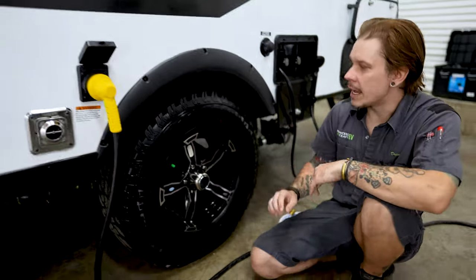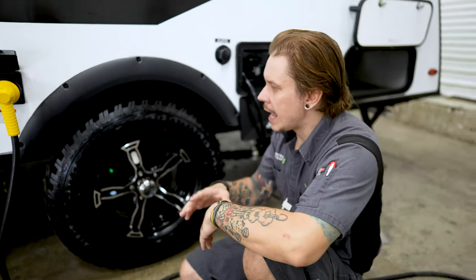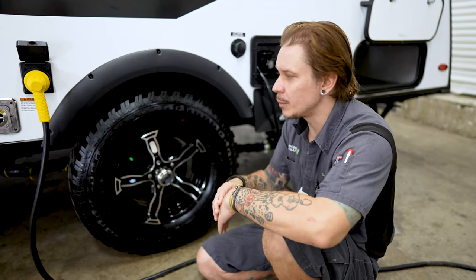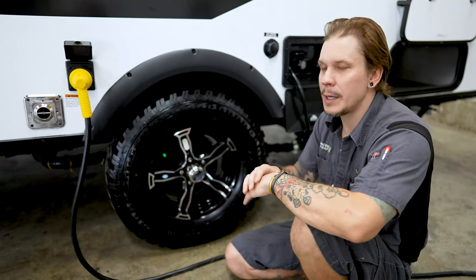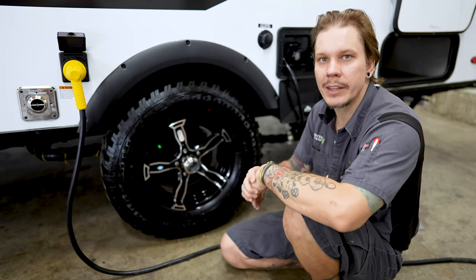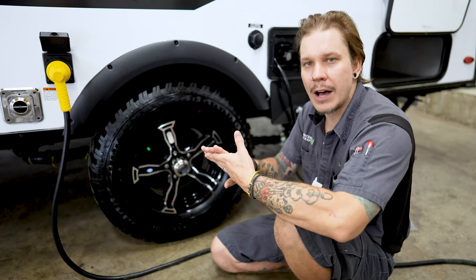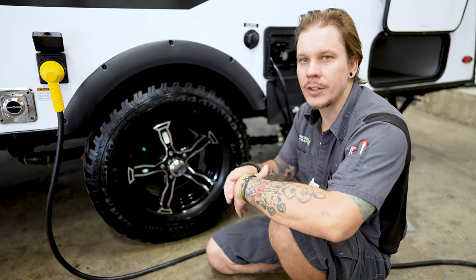Moving on, we have our tire pressure and lug nuts. These are very important with any camper. This unit is going to utilize a max 50 PSI tire pressure, and with any trailer tire, you do want to run them at the max. That 50 PSI is going to give us the highest flexibility in terms of weight rating, whether we are completely full or completely empty. These lug nuts have been torqued in a star pattern to 100 foot-pounds here in the shop. Every manufacturer recommends a re-torque procedure, generally falling within the first 15, 25, 50, and 100 miles of initial travel — the manufacturer wants you to stop and make sure these lug nuts are maintaining that 100 foot-pounds of torque.